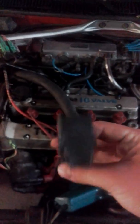And also there is what I call the distributor finger, which rotates inside, and the spark jumps from it, and it has a really small area to jump the spark from. So if you set 15 degrees, there is a chance of it not sparking correctly because it doesn't have the metal in front of it anymore. So to upgrade ignition, you should buy these. These are ignition coil packs, coils and plugs.